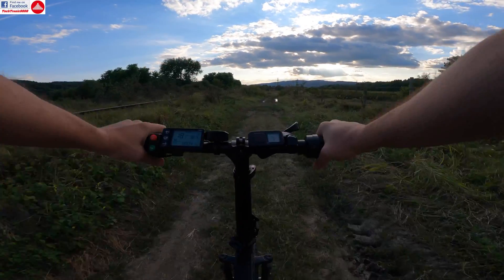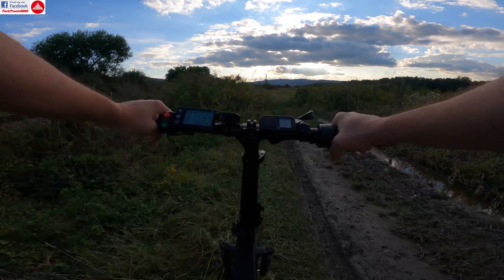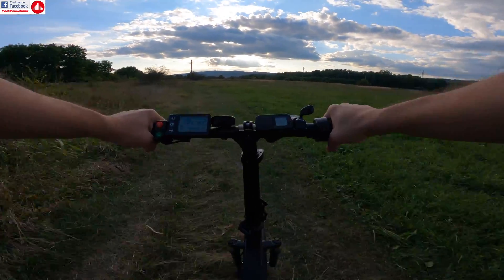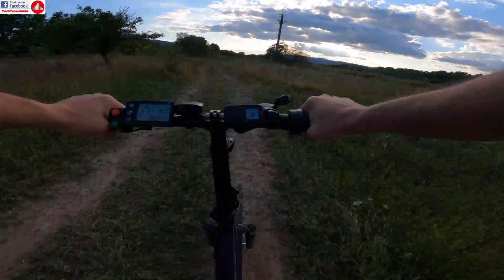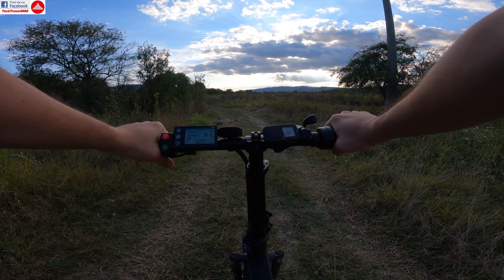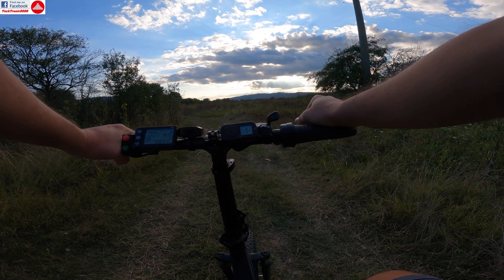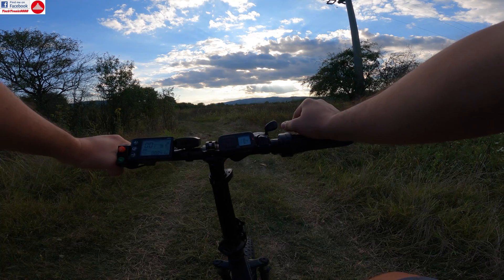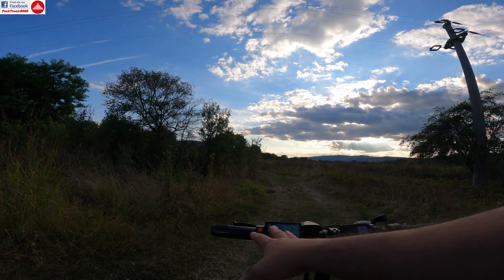There's that mud again — I hate mud. I need more gears to get some speed. The second assist mode in hybrid mode gets you up to 25 kilometers per hour. So in hybrid mode you have two gears: one slow and one fast. In assist-only mode you get three gears with one in the middle at around 20 kilometers per hour — so 15, 20, 25 — and that's how this works.